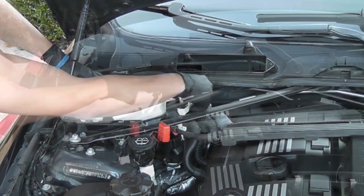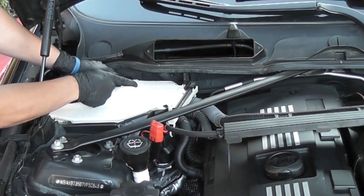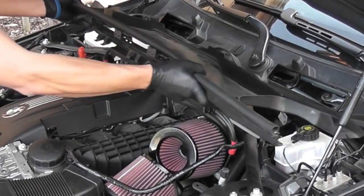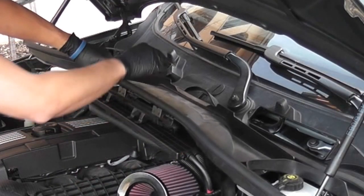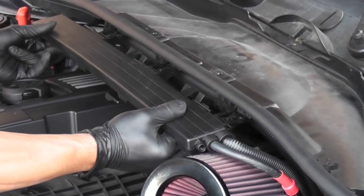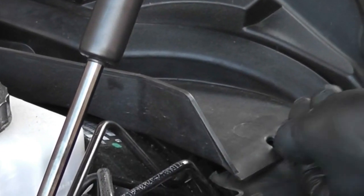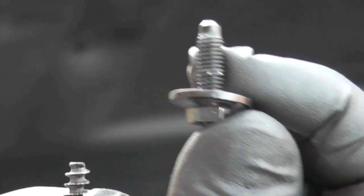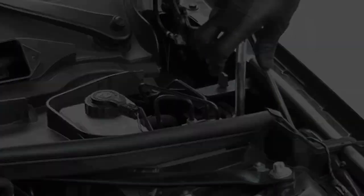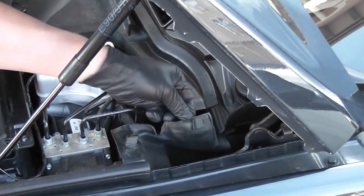This particular cover may take a little bit more effort, so be patient. If it is going in very difficultly, please double check the wires to make sure there is no binding or sharp edges. Reinstall the bulkhead — locate the center point of the bulkhead and the firewall for ease of installation. Reinstall the wiring loom by placing it into the three slots and clipping them in place. Next, reinstall the rectangular assembly by pushing in firmly until a click is heard. Reinstall the rubber seals on the passenger and driver's side. Use a fine threaded 8mm bolt to reinstall the side of the bulkhead. Repeat this step on the other side. Reinstall both black covers on each side, noting that each side has two rubber tabs that are very critical for proper drainage.